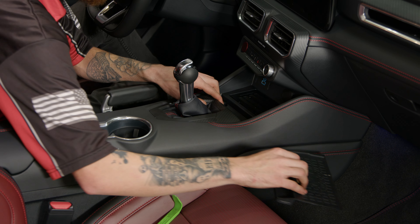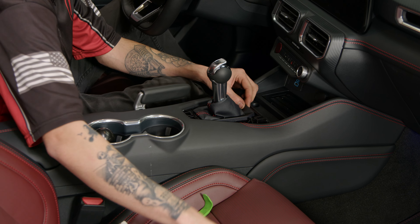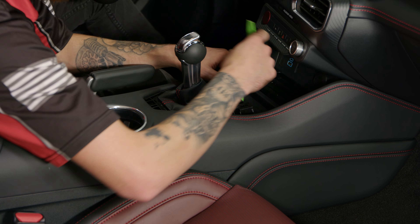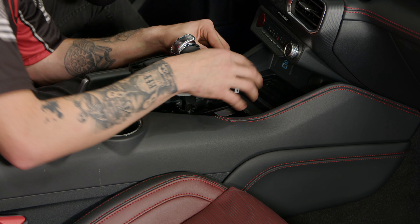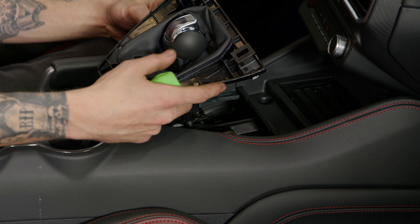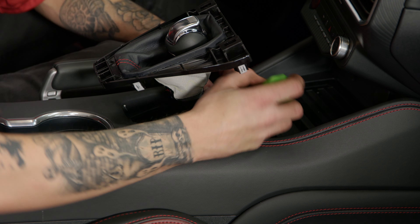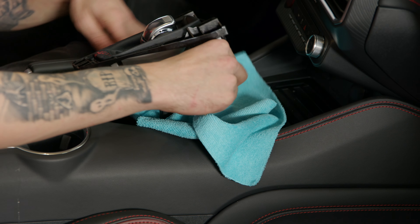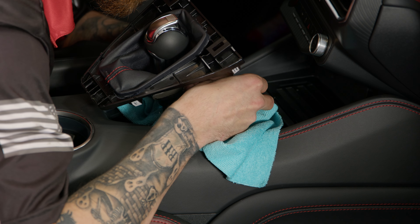First, take out this pad here to make it a little bit easier to get a grip on the cover. Now the cover's off — it's just held in by clips. After you get the cover out of the clips, pull it up, and there are gonna be two Phillips head screws on the front of the shifter that you're gonna wanna loosen. Make sure not to drop these. If you wanna be extra safe, throw a rag around here — that way, if you do drop them, they'll fall into the rag and not into the transmission. One Phillips screw on the bottom and one on the top.